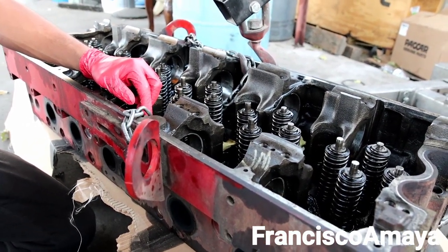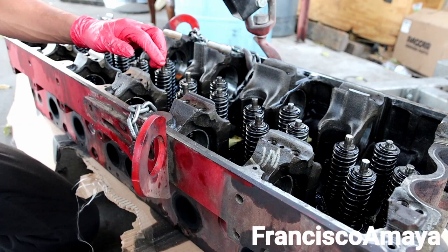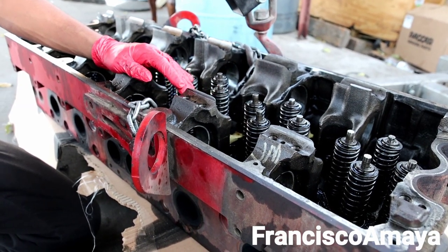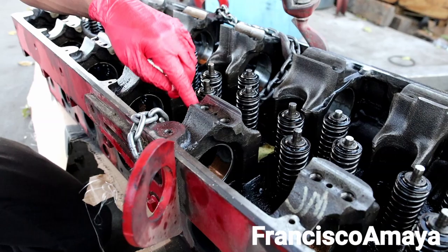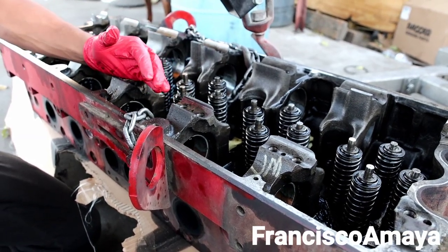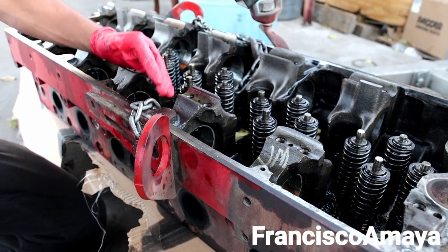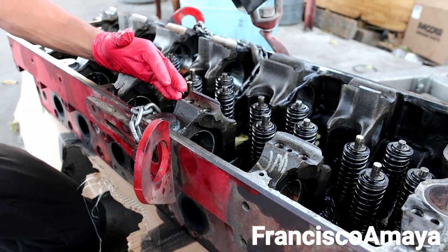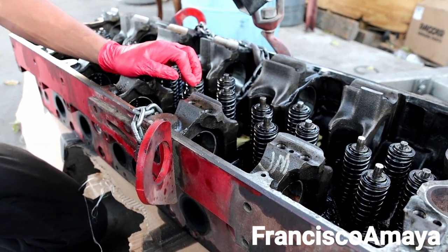It is very important that if you are having oil pressure issues on your Cummins ISX, you pay attention to problems like this. If you don't, you can destroy your engine. Over time, the pressure drops a little and the bearings start wearing out until the crankshaft starts making metal-to-metal contact, because the bearing is no longer preventing direct friction to the crankshaft. That leads to major problems like the engine seizing or making serious noise.